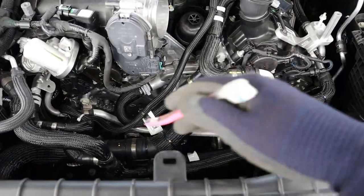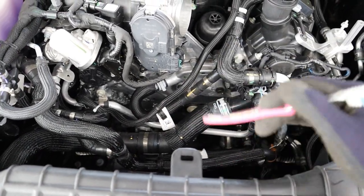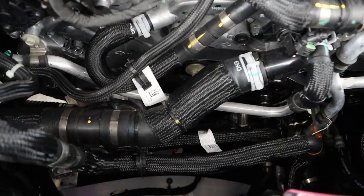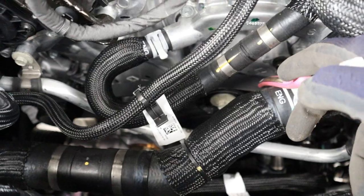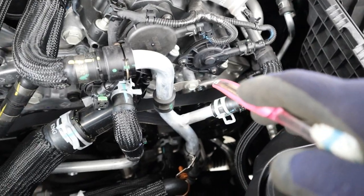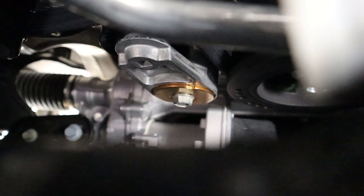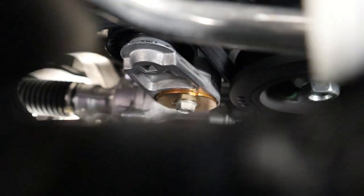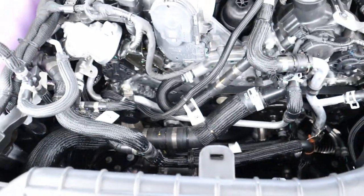Taking a look at the front of the engine where all the accessories are, there is a lot of room in here but that's mostly because this comes with a V8 option and this is only the V6. Once you take all the jungle of hoses out of the way there's a drive belt inside that's pretty easy to access. You can see the drive belt, the alternator on that side, the AC compressor on the other side, and the water pump somewhere in the middle. Removing the drive belt is actually pretty easy — you can see the belt tensioner with that square on it, put your ratchet on it, turn it to remove the belt tension and remove the belt.